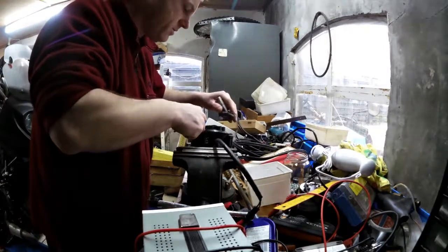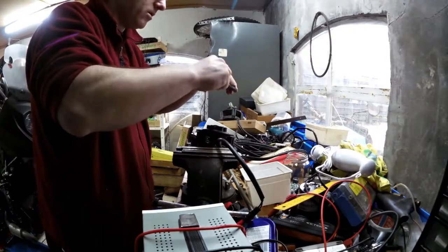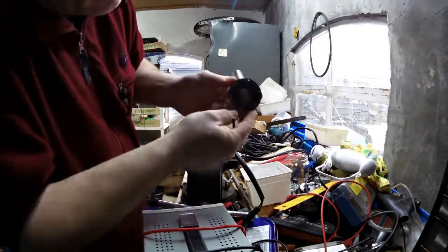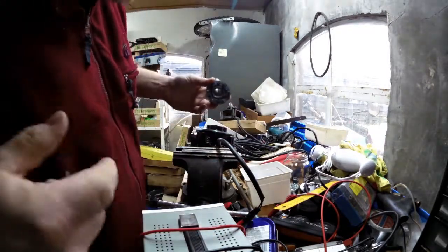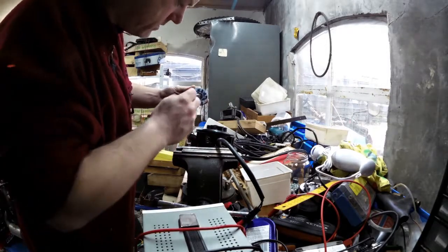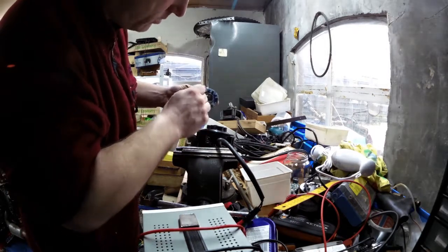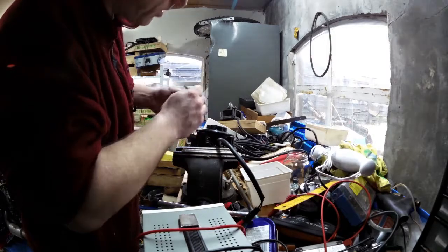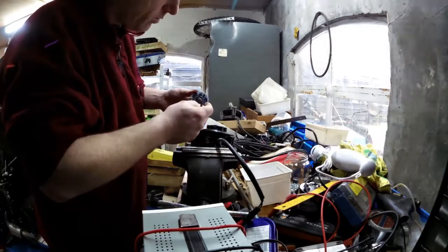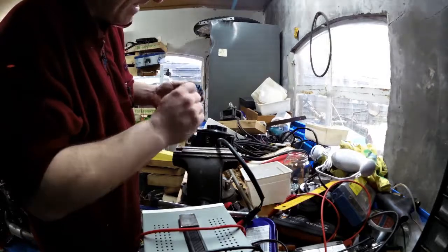There is a lot of sealant in here. This is, I think you did this then. You know, it's not horribly bad. The light is not too good. I see. There is supposed to be an O-ring in here, because this is a lower area and there is no O-ring. So the O-ring is missing. Probably blown, or, and this gasket is just ghastly. Ghastly gasket.